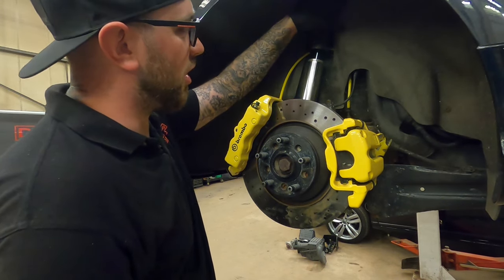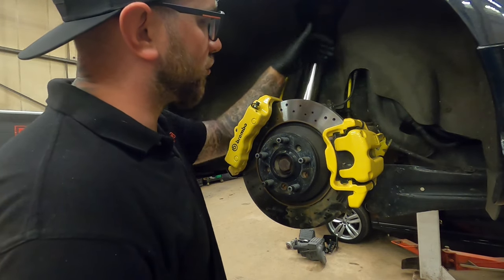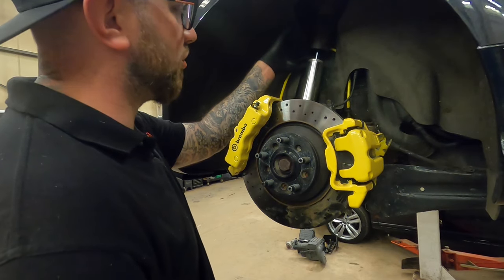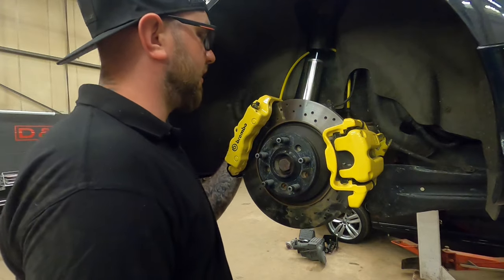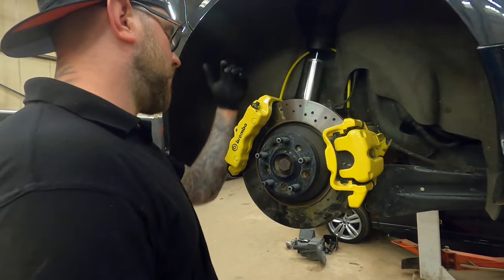As you can see, on the wheel arch liner there's kind of a gap where the sensor wire goes through and then the screw in it. So I've just looped it around the back and put the screw in. This just stops it from coming forward and fouling onto the shock or anything. It's been on a while and I keep checking on it. It's not rubbing or anything, so it looks fine. So I just routed it up and round to the car.